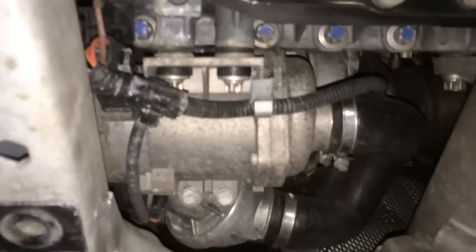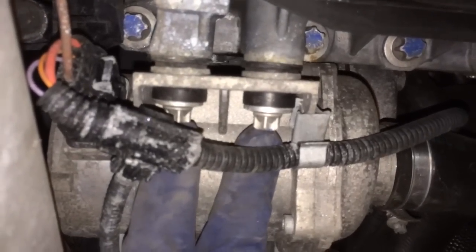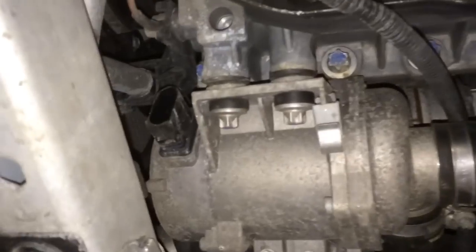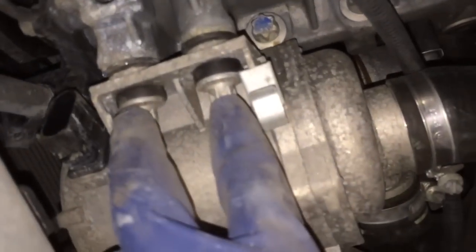Now you can look up in here and see your water pump and thermostat. The thermostat is here, bolted to the water pump with two 10mm bolts. You can see the two lower aluminum bolts that hold the water pump assembly to the block, and the electronic pigtail back there. Take the electrical connector out, unplug the pump, and you may have to undo a ground cable here if you have a 328. Then just start loosening the hose clamps and pull the two lower E12 E-Torx bolts.